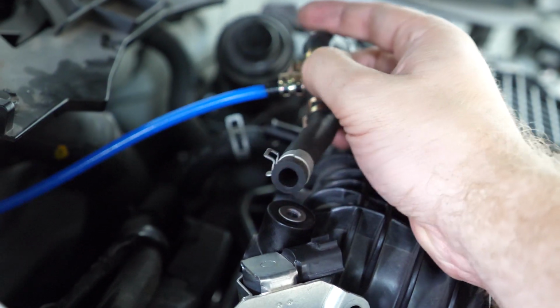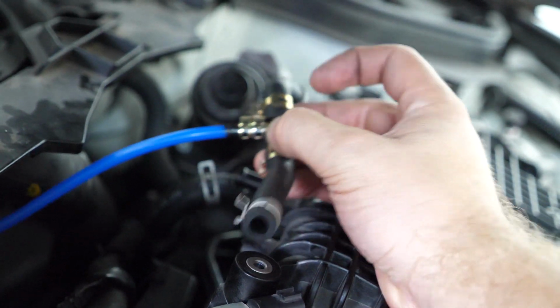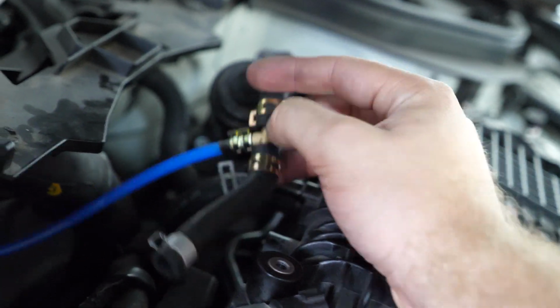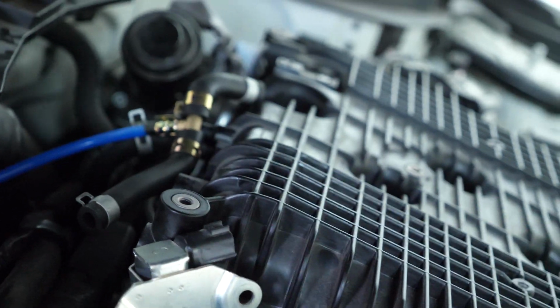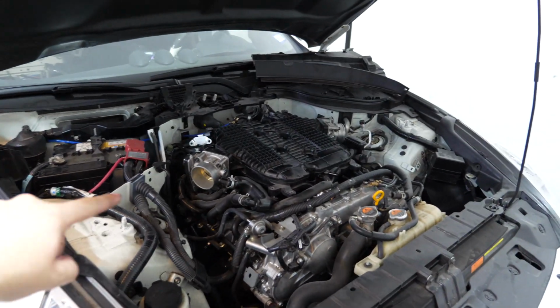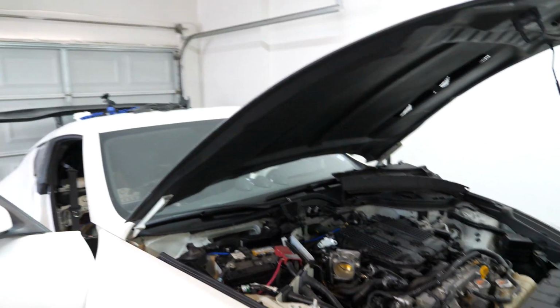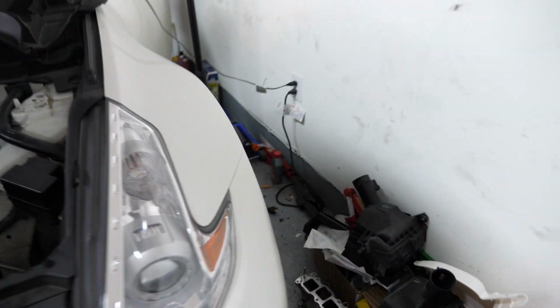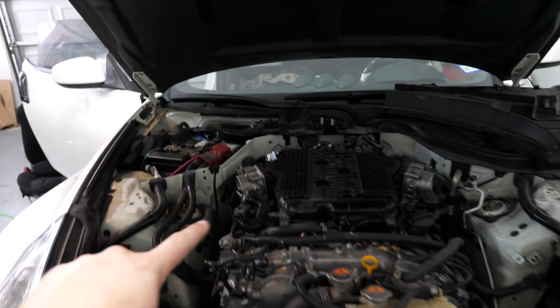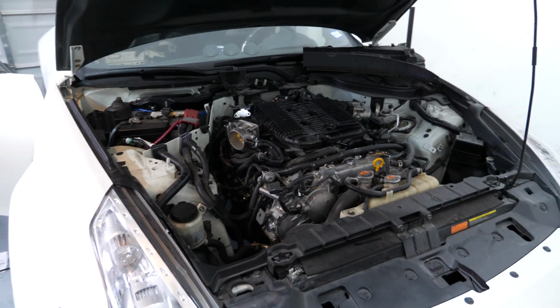But you want to make sure you give a firm tug on this line just to make sure that it's not going to slip off as you begin to hit boost, because you really don't want to have a major boost leak like this. So I'm going to reattach this evap hose, and I'm going to end up reassembling the rest of the car, because in the next video we're actually going to be test driving this entire system to make sure that everything is working properly. So I'm going to reinstall the factory air boxes and things that we took off when we were doing the fuel injectors, and then we'll start working on the wiring.